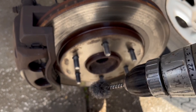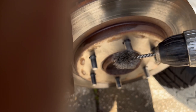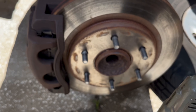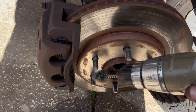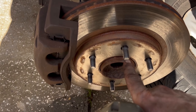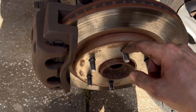It's entirely up to you guys, but before I put the tire back on and the lug nuts, I use a drill with a little wire brush on it and basically just go over the lug studs. Just try to make sure there are no burrs or anything in them. You can't take the lug studs out without disassembling the entire thing, but if you have something like this or even just a wire brush, get any burrs that might have come off. It will help in the long run. If you get something in here and it strips the stud, you have to punch it out and have it pressed back in — it's a lot more of a pain. Wire brush these before you put the wheel back on.